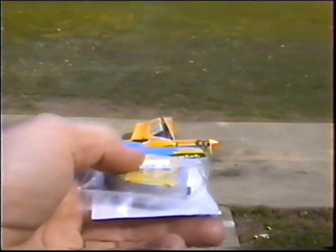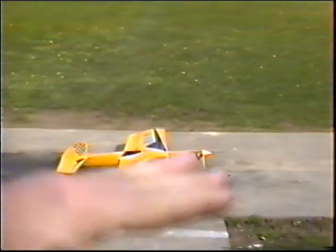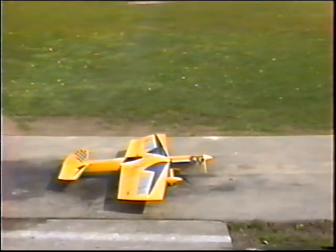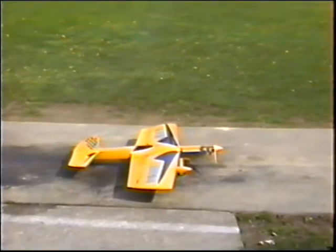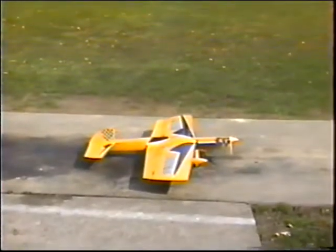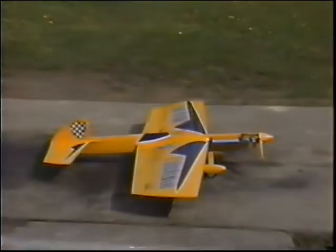And I can compare. I'll have one other test thing. Plus, I think this will make it a little more aerodynamic to some degree. The thing that's negative about it is I'm trying to get the weight lower in the CG so I can reduce the tab. And this muffler will do exactly the opposite, but it might not do it enough that it matters. And we can get a gauge on how the motor runs with both mufflers on the same day with the same prop.